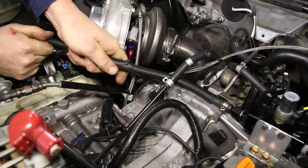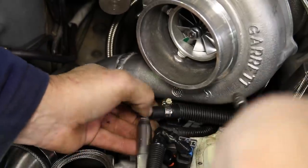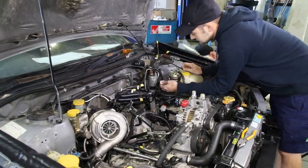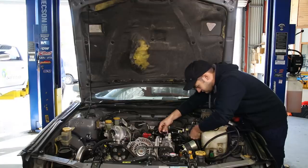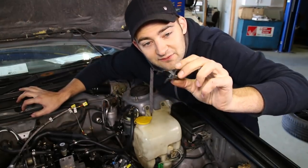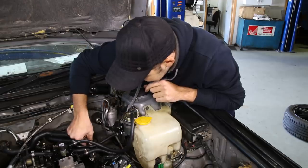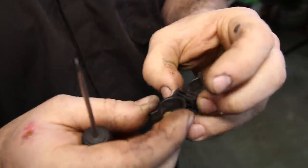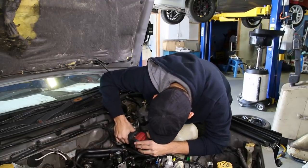We're adding some loom tubing over the fuel line anywhere it's likely to rub, as it is a tight fit under the compressor housing. Our flex fuel sensor can be installed onto the return line - it will tell the ECU the ethanol content of the fuel once we start running E85. Our rising rate fuel pressure regulator increases the fuel pressure depending on the manifold pressure, or in simpler terms, boost. Next time you're pulling a car apart, grab as many of these clamps as you can get your hands on - Turbo Yoda and Dos Vader have a whole bowl full of them. You can put one on a heater hose and one on a fuel hose to stop them rubbing together, which means no leaks and it looks super neat and factory. Our flex sensor is going to be bolted down to our passenger side rail where it's out of the way.